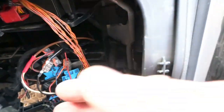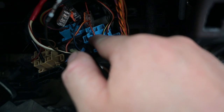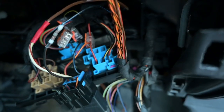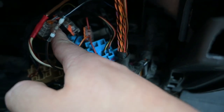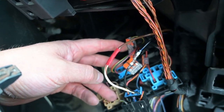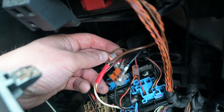The other two wires are straightforward. Your red and yellow — just tap into the feed. The red and brown on an existing relay goes into number 3 — that red and yellow taps off the red and brown at pin 3, which has an A next to it. That completes that wire. Then you've got blue and black, which can be tapped into the yellow and black on the other relay. Your blue and black goes into your yellow and black off your other relay — that sorts the feed for that.